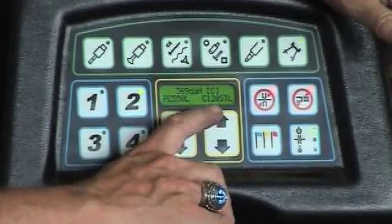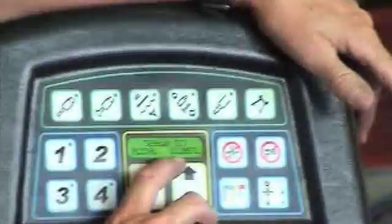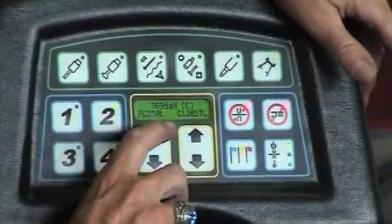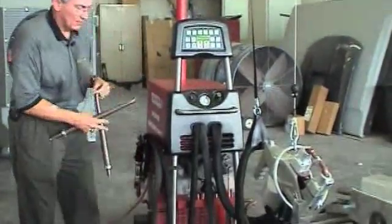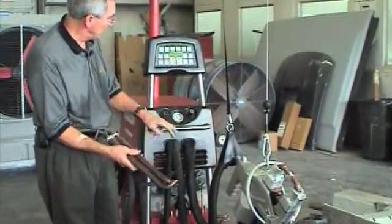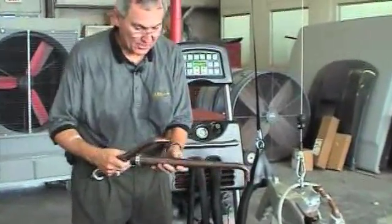set we've installed on it. Now these are 120 millimeter arms here, so we're looking at 120 millimeter arm here so that we can predict the amount of squeeze pressure. As the arms get longer, like these, the available pressure will drop and we may need to adjust here on the gauge. So each arm set is stamped with an identifying number, and we scroll through the setup